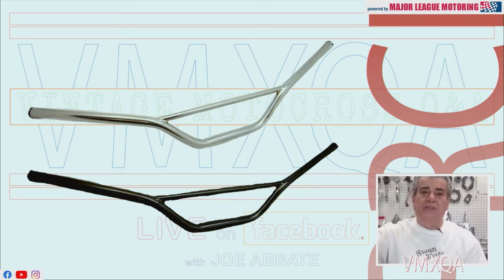There's a copper finish, there's a nickel finish, then there's the chrome, then there's the polishing. The amount of heat that comes out of those mixtures, out of those batches and those vats, is nowhere near as hot as one might think. No, it is not going to affect the strength of the chromoly on those bars.